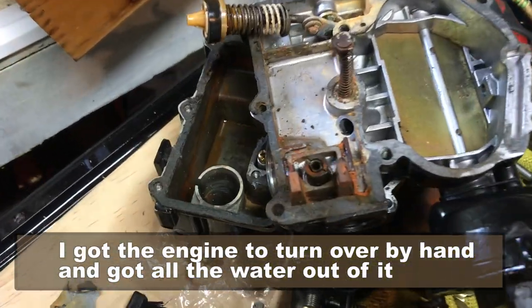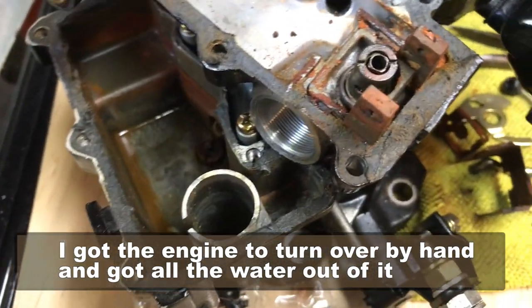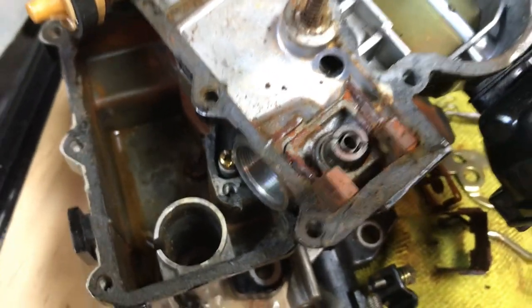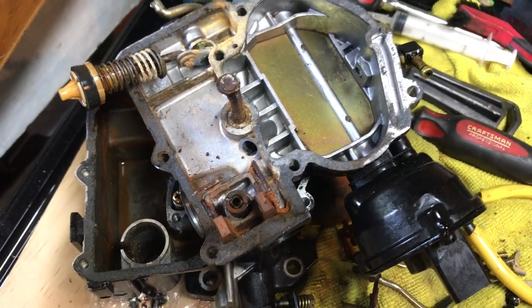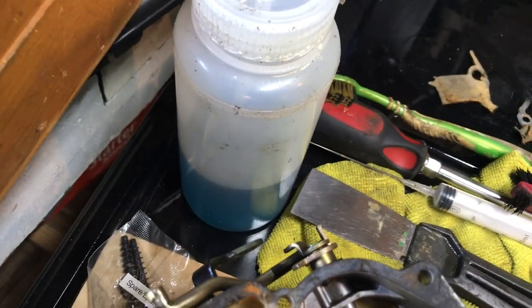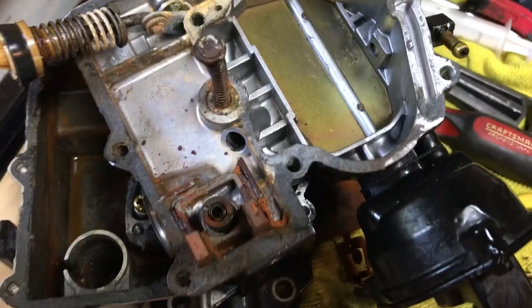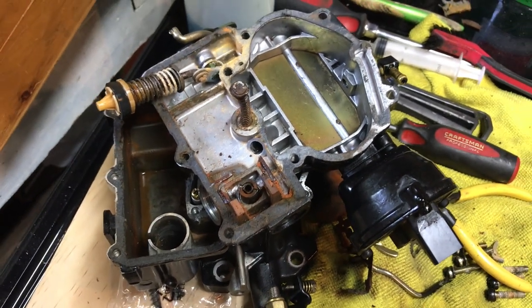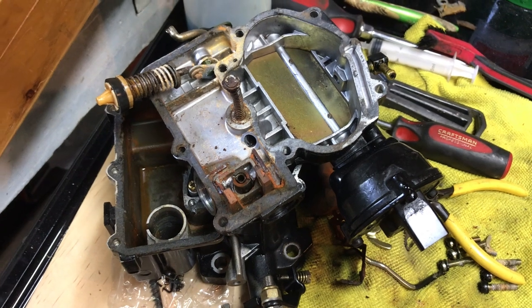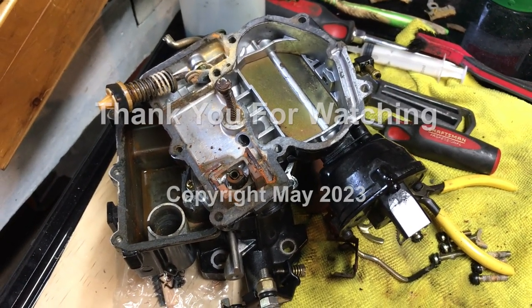For the motor itself, all I have to do is rebuild this nasty carburetor — it had water down in there, which rusted some things up. I've got a rebuild kit on the way. It runs on bottle-feeding — just squeezing fuel in — and it runs like a champ, so the engine is good. I just need to get the carburetor back together and the boat is good. Something that seemed so bad turned out to be a simple fix. Thanks for watching — hope you enjoyed this, we'll see you next time.